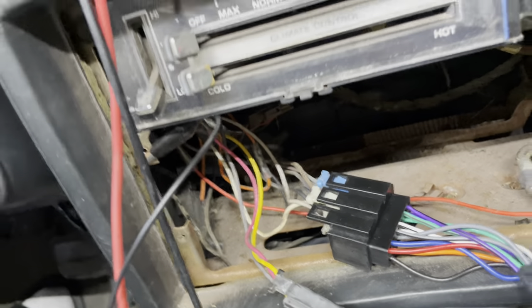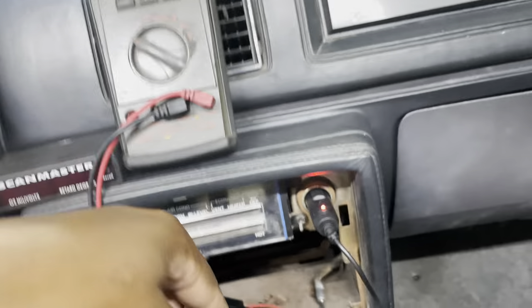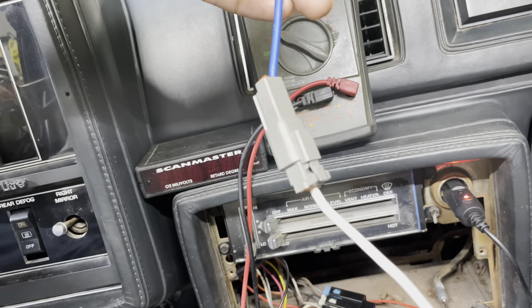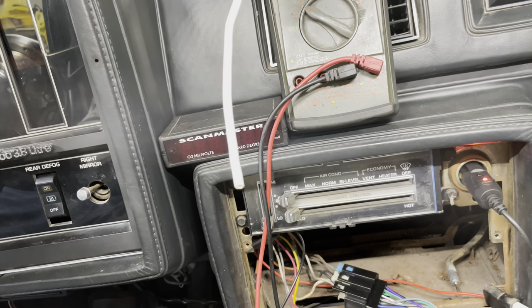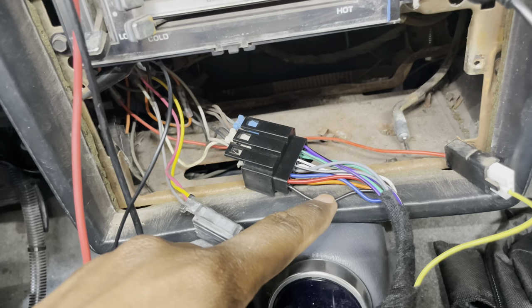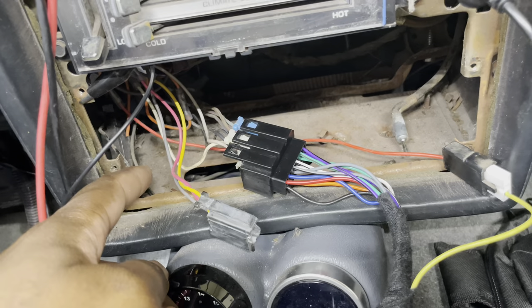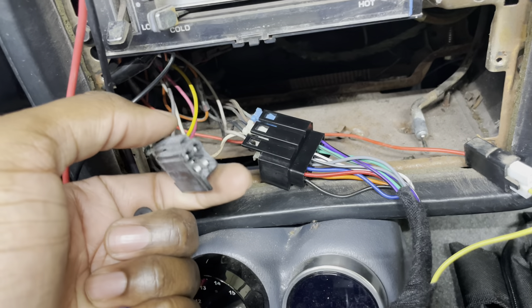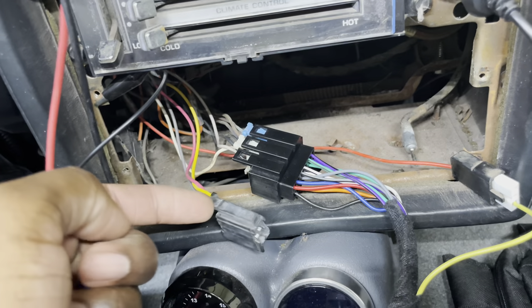Here's what I'm going to do about it — I have this wire, I'm going to use this screw to ground to a metal spot within here, and I'm going to have a harness connector so I can separate it whenever the radio needs to come out. On the other side of the white wire I'm going to tie that into the black wire right here, so I'll be grounding from the dash frame over to this connection. If I had a terminal I would de-pin this and just pop in a new one, but unfortunately I don't.